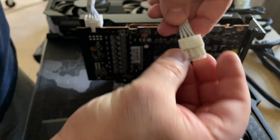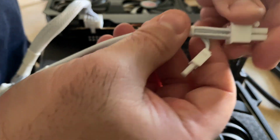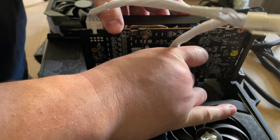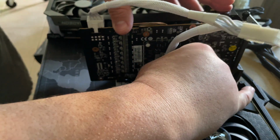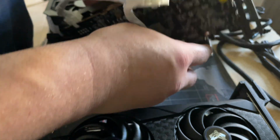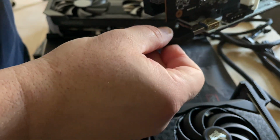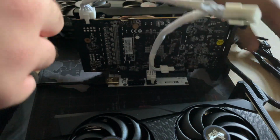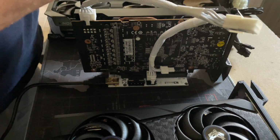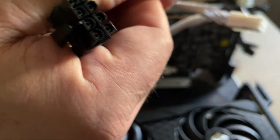She's in there. And then I'm going to go ahead and disconnect one of these adapters. And now it's a 6-pin that goes down into this. And these risers have 2 power ports. They have one on the side, they have one underneath. I go ahead and plug the USB in the bottom, just like so. And then the last thing I've got to do is connect my VGA cable to the adapter.